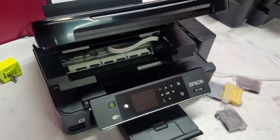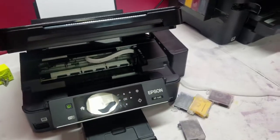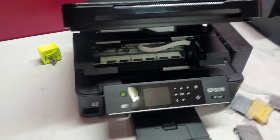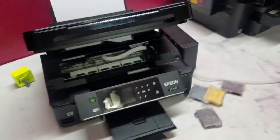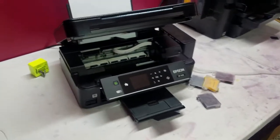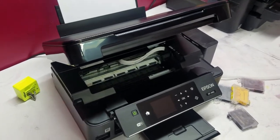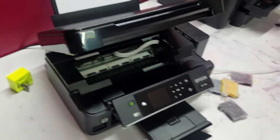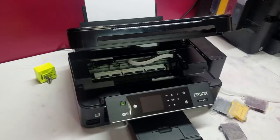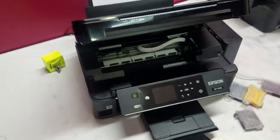The first step in sublimation printing with these Epson printers is to get a chipless firmware. It's not to go get the cartridges. It's not to find out what ink you want to use. Make sure that the printer that you have supports a chipless firmware. Not all printers do, some of them don't. So find out if your printer can get a chipless firmware. I'll put a link in the description to where to find the instructions on installing the chipless firmware. But yeah, now we'll go ahead and tear it down.